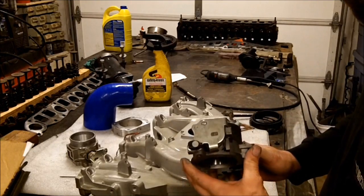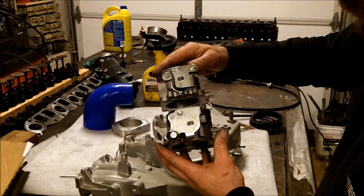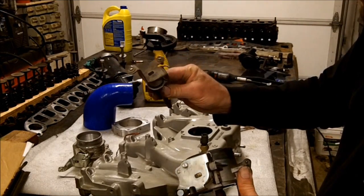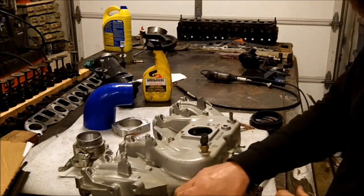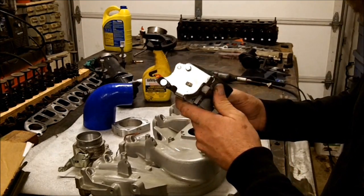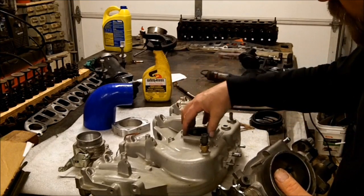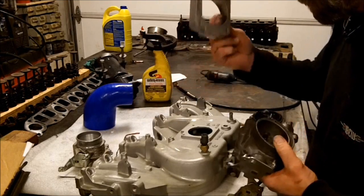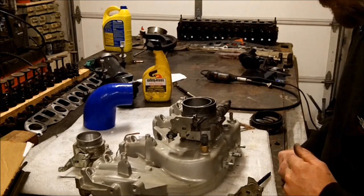The one difference would be the linkage for your throttle cable, your kickdown cable, and cruise. What I'm going to do is I've got a shaft pulled out of another throttle body right here, and I'm probably going to start by grinding this down and adapting this piece onto here, then do some cutting to make it all work. That's going to be the biggest adjustment to this particular throttle body. Then we're going to have to build an adapter plate going from this bolt pattern to that bolt pattern. I'm going to try to keep it down to three-quarters of an inch thick.